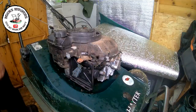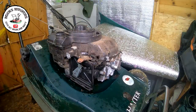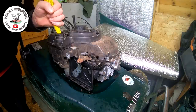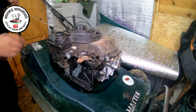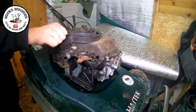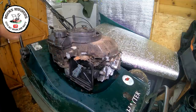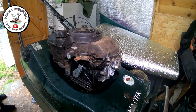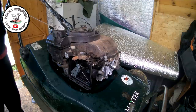Is there any fuel in there? A very small amount — let's put a bit of juice in there, just to wet its whistle. Fuel cap on. Right, so now we've actually got a choking carburetor which it wasn't before — the cable had just slipped. Lovely. So let's put it onto choke, dead man's handle in. Open the door a smidge — I don't want to whack my hand. Nothing. Okay, off choke — the carburetor will flood.